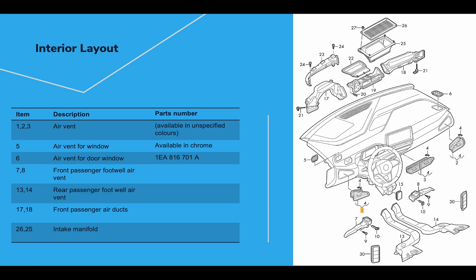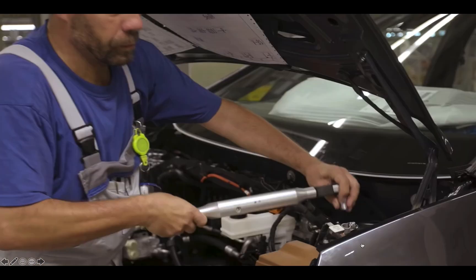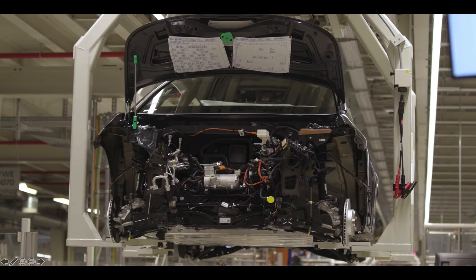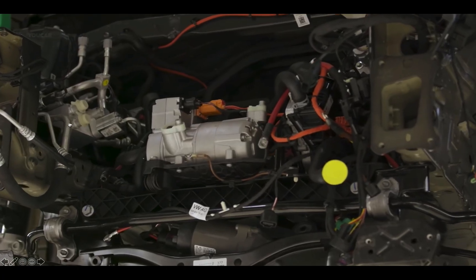Before we go under the hood, let's watch this construction video of the ID3 and I'll pause it to call out the key things we're interested in. Here as the ID3 is rolling up, right in the middle you have the compressor unit — that's the core component of the ID3's HVAC system. The compressor is shared between both the cabin cooling loop and the battery, and it's also used as a compressor for the battery heating or cooling loop. You can see all the different pipes for the refrigerant lines, though the radiator and other pieces are missing from this diagram.